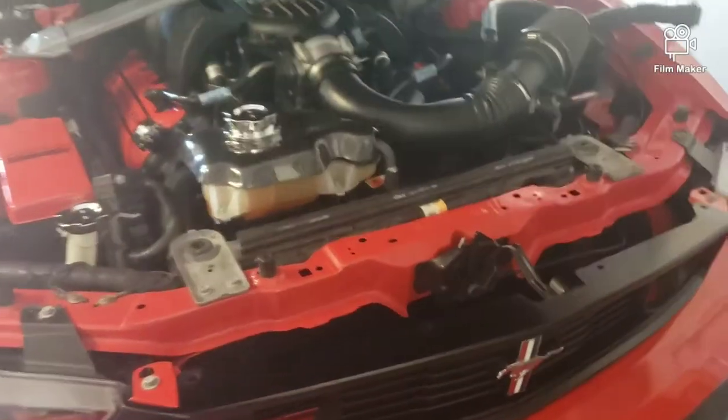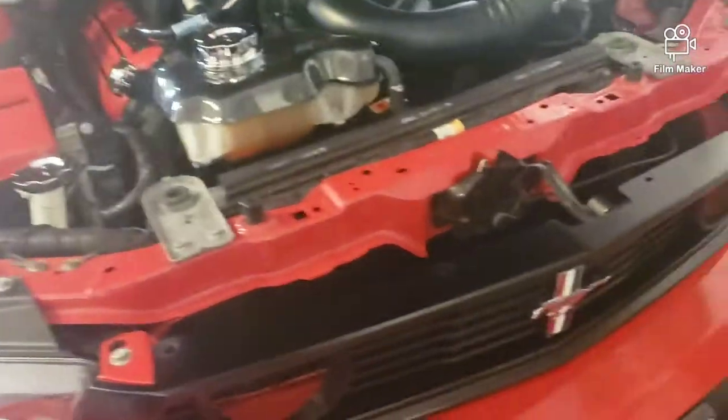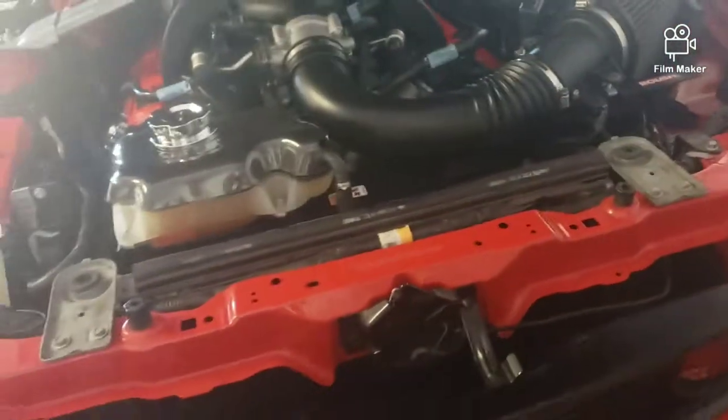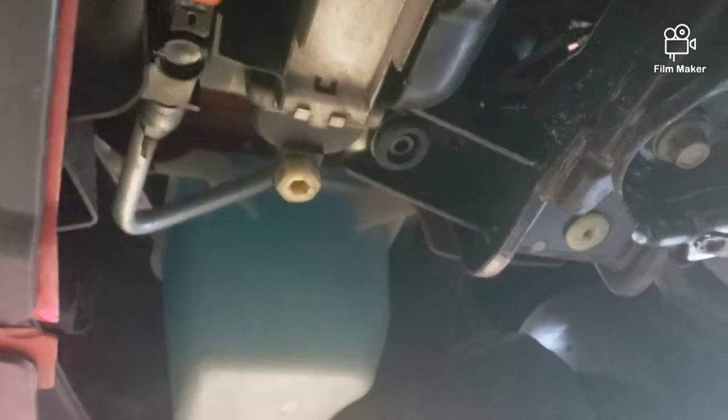The first step is to remove all the covers. I went ahead and took off the top radiator cover — there are a couple of push pins, you just pop the pin then pull it out so you don't break them. I also need to move the sound tube, but since I ripped it off I'm going to delete it for now. Another thing you have to do is remove the splash guards — there are a bunch of little screws all the way around that you take down, then you can drain the coolant.